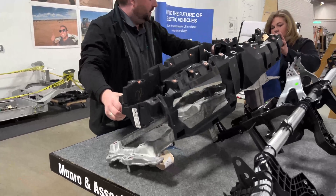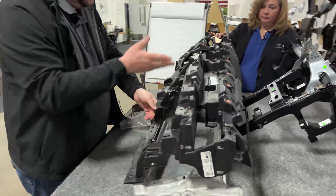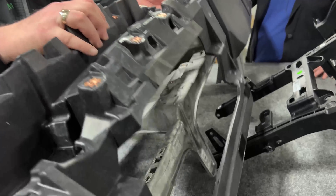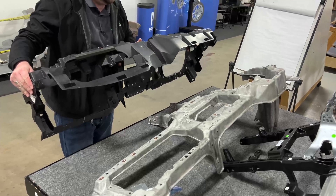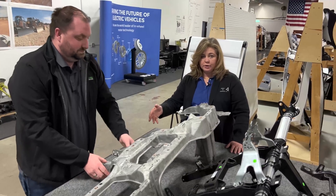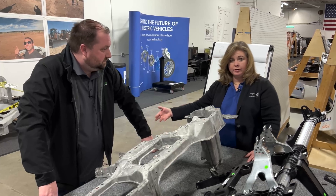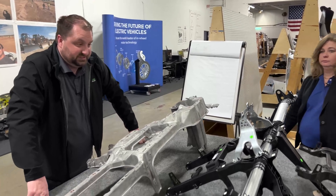However, I think they did a bad job on this one. You have the opportunity to cast in all of your attachments, yet this vehicle also has a separate carrier — and this carrier has nothing to do with structure; it's all providing attachment points for trim. It seems like a waste that there is still a top pad on here and then a separate carrier just providing attachments. That carrier is a very expensive part that it would have been nice to get rid of. There is even more structure in the top pad that probably doesn't need to be there and adds a lot of weight.